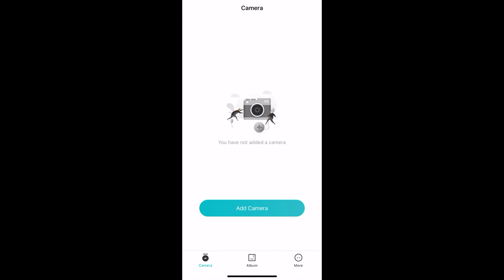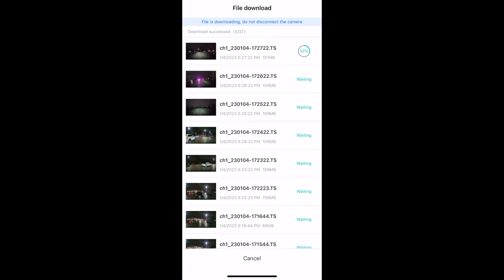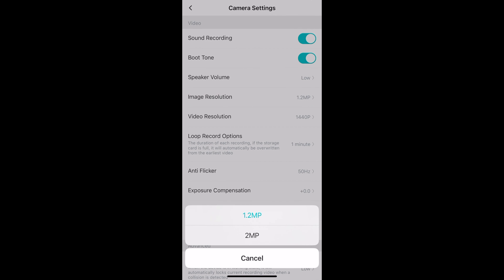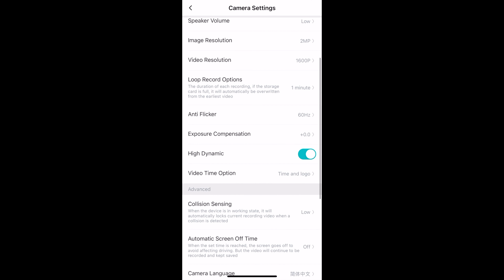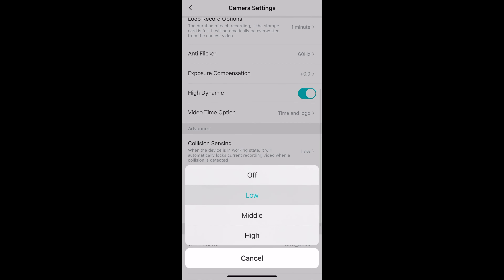In the app you can view live footage being recorded, take a snapshot, download previous footage, or change settings. Footage takes about 30 seconds to download per minute of video, which is not bad at all. In settings, the camera defaults to 2K or 1440p, but I switched mine to 1600p which is 2.5K. After importing the footage into my editing software, I can confirm it does record at 2560 by 1600 at 30 frames per second — which answers my earlier question about resolution.